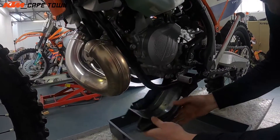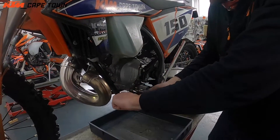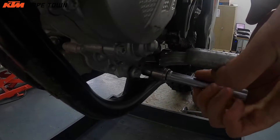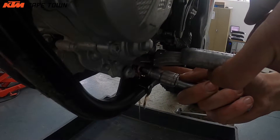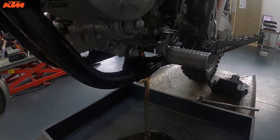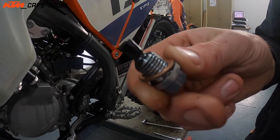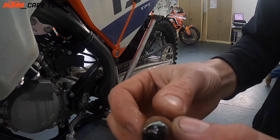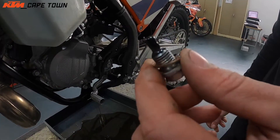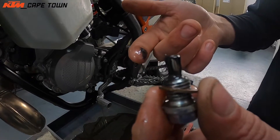Let's show you the actual task of draining the oil. Obviously start by taking off the bash plate. Use the breaker bar to crack the drain bolt loose, as it can be a little bit tight sometimes. You can see the oil is hot and flowing nicely. You can inspect the drain bolt upon removal — if you have big chunks of metal shavings on it, you know something is not right: gears or bearings collapsing, or gears chewing or breaking teeth. This one is not too bad at all — just the usual bit of wear and tear. It will be cleaned off and installed with a new copper washer.